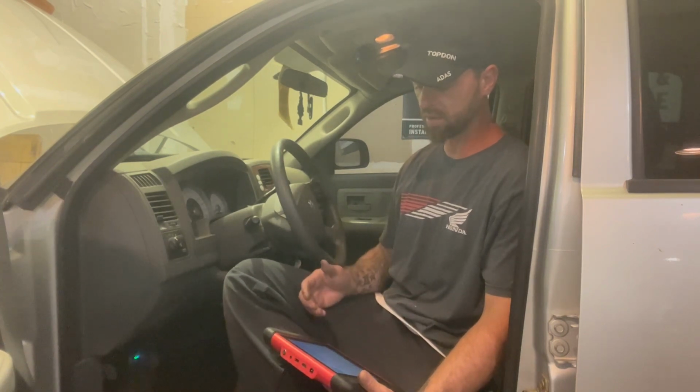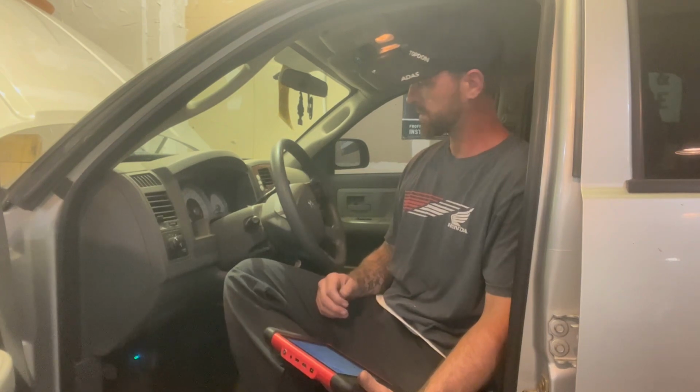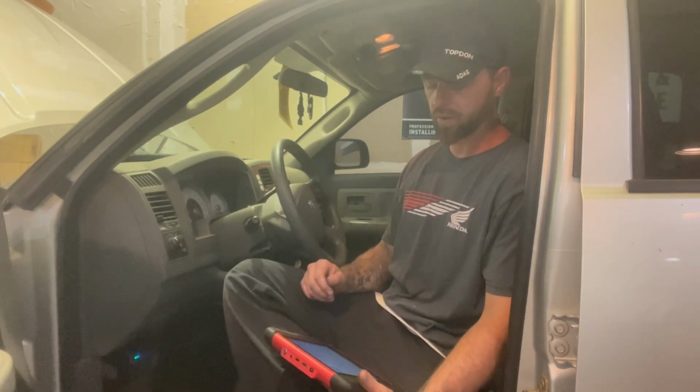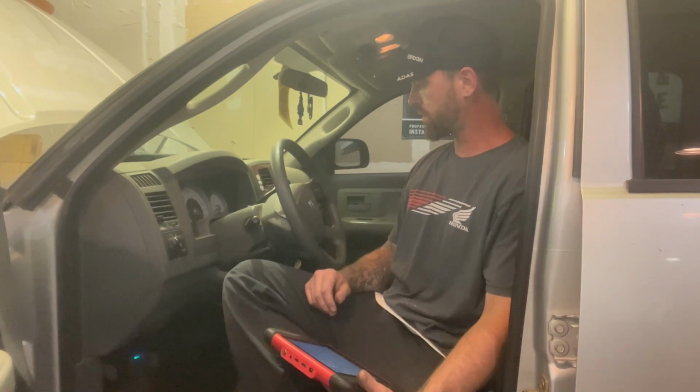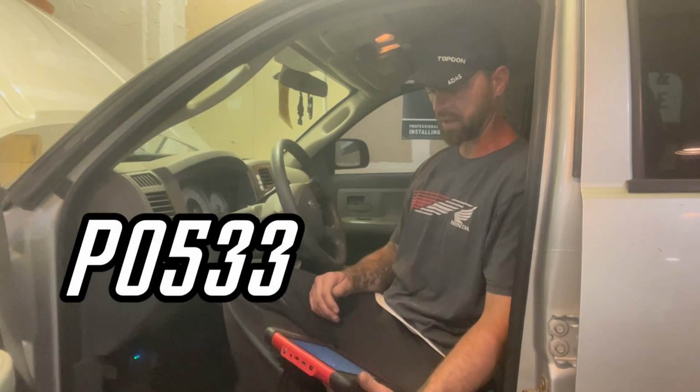We got a pressure sensor code, so I don't know. So yeah, we got a P0533, and it's the AC pressure sensor circuit high, and that's pretty much all I got right now for you. But so yeah, I just wanted to see if there was any code stored, and there is.